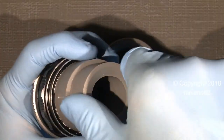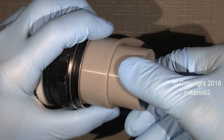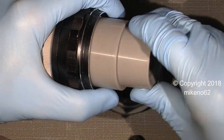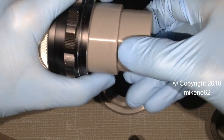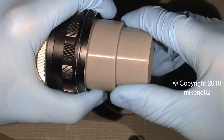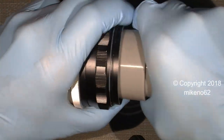Let's see how it actually looks through the lens. Oh, there's still something on the back here — on the inside — on the back of the back lens element on the front lens group. Sometimes it's easy to take away and sometimes one is not lucky. This plastic ring is a bit annoying, but it sits there. Now this ring comes on and this one to tighten it — this is safely in place. There was something on here which needs a little attention, so I'll use some Eclipse to see how it will go. Yeah, that's really, really good — much much better. I will simply just put this lens back into the lens assembly and put the nameplate on, counterclockwise to catch the thread.